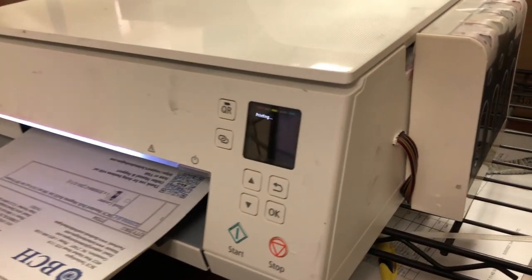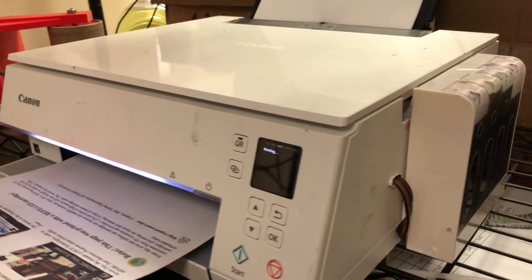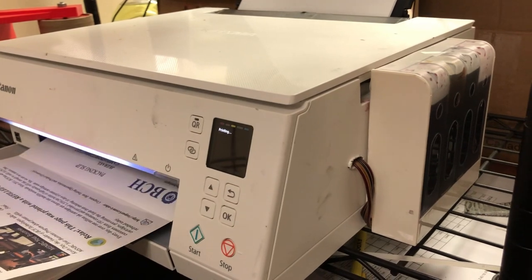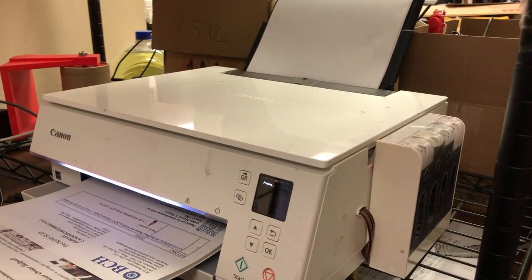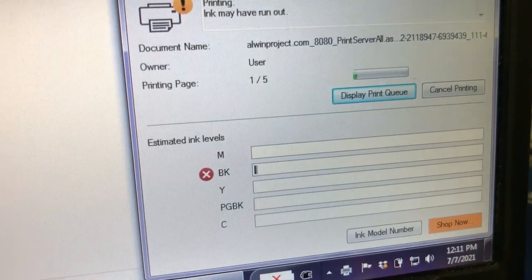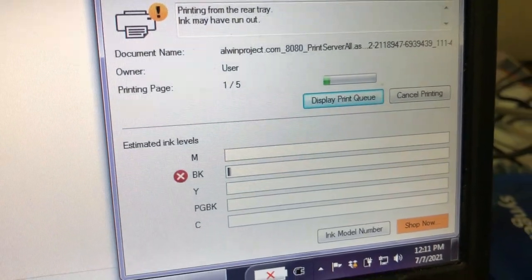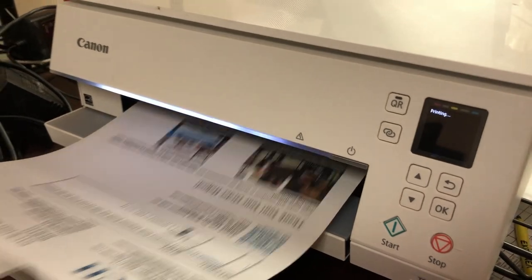You can see that even with the ink monitor turned off, I can print normally. By the way, you cannot turn it off right now because you haven't printed enough pages. Eventually, what you want is something that looks like this — almost all the ink turned off except the BK, and the printer is still printing.